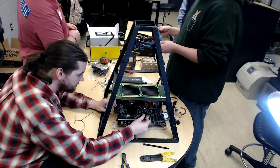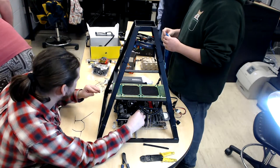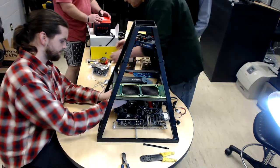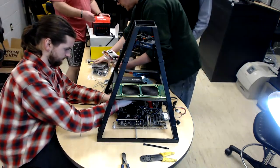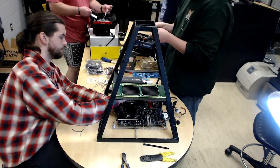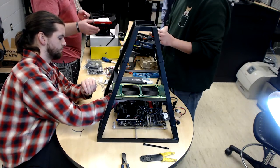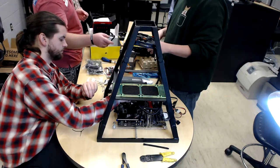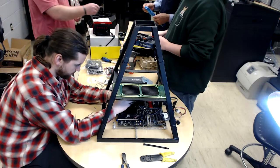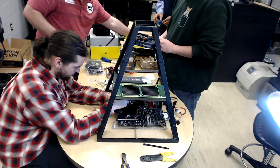So the one problem with the fans we brought, Mr. Tree, and this is on me, I didn't look into it enough. The hot boy fans, they have a proprietary connector on the fan. It's not the traditional 3 or 4 pin in the AIO thing. It's this weird connection. So it only connects to its fan control. If we had regular fans, then we could connect to the fan controller here, the nice one that came with. That's the fan controller? That came with this. Okay, we can plug it on the board? We can, and we're going to have to get the thing to light up in the center.